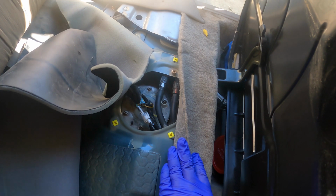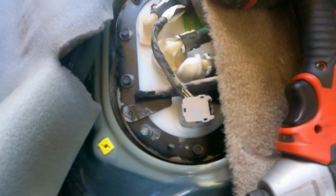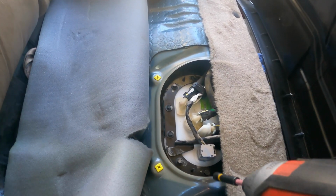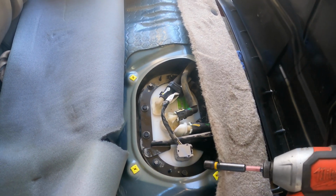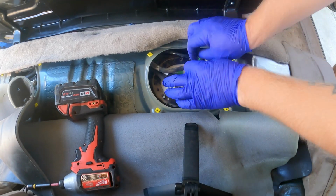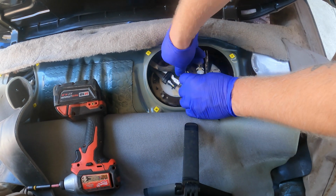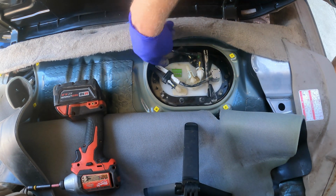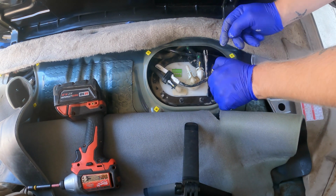And he started in the completely wrong spot. And this is the fuel pump over here. And I think I just mentioned we're gonna be replacing just the electric pump, not this whole assembly. So let's get these lines disconnected first. Start by squeezing these white tabs together. I'll start at the one I can get to. Don't forget to disconnect your battery first. I did do that already.